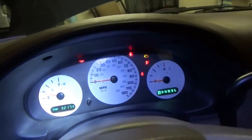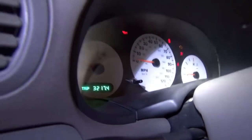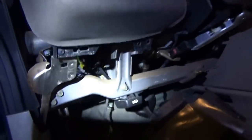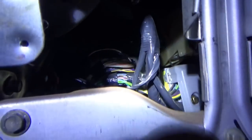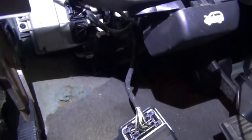Sure enough, after waiting a little bit, the cluster is back online. I'm going to gently wiggle this harness and see if — yeah, we definitely need to go towards these wires and check them one by one. Got the panel off for better visual access. The top connector has our fat power wires — see the white and red and brown and red. Let me check those with my bright test light, though it's a tight fit to get in here with a probe.